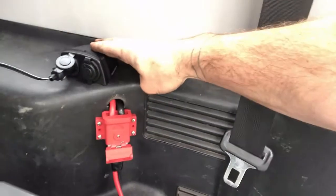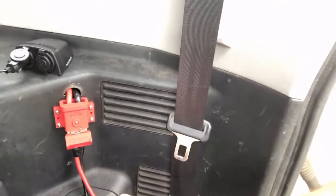One other thing worth noting — I've installed a twin cigarette lighter unit next to the Anderson plug for the dual battery, using thicker cable. The reason I did that is if you want to run appliances that draw current off your car battery while camping, most factory four-wheel drives have a thin cable, which can pose a fire risk if you're drawing too much current.